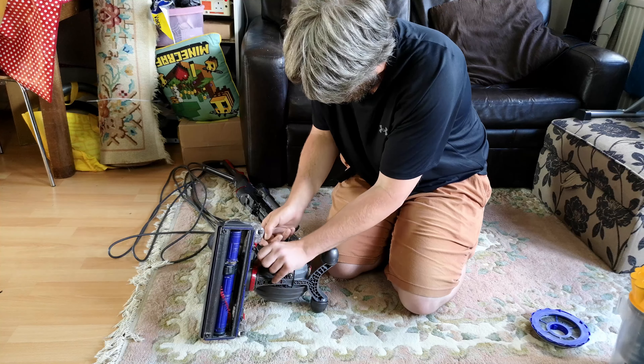Look — the pivoting bar gets full of fluff. You won't see it from this angle, but in that join there it's full of stuff. You can remove some more screws if you need, but what we're going to go straight for is the brush roll screw. The brush rolls are quite worn as well, which is a little bit of a shame, although I've seen worse.